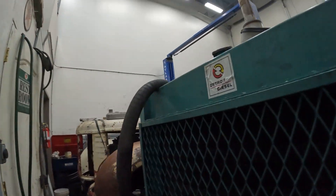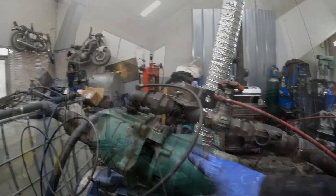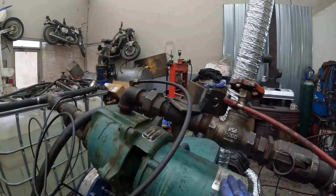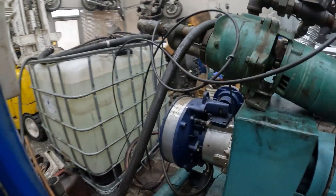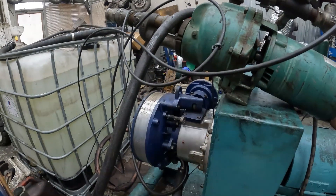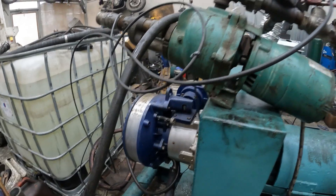I'm running into another issue though — I'm overwhelming the pump. I can't pull the RPM down with a full load of water. I'll go have a look at this pump. It's supposed to have a 45 PSI feed to the dyno and I'm only getting about 25. So I'm not getting enough water pressure to load up the dyno.